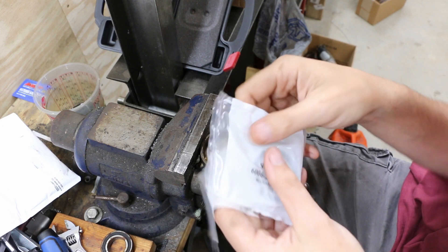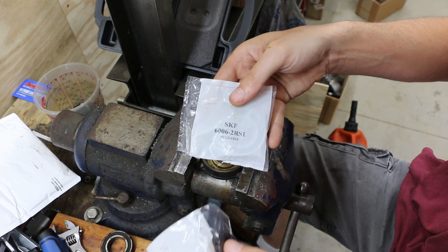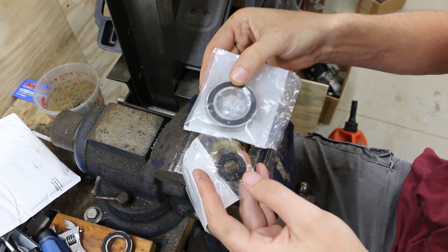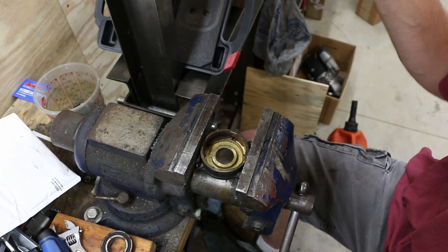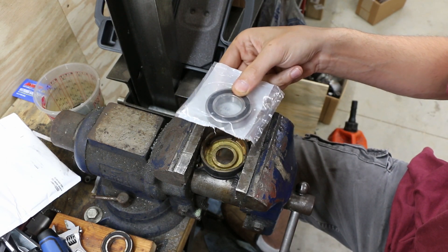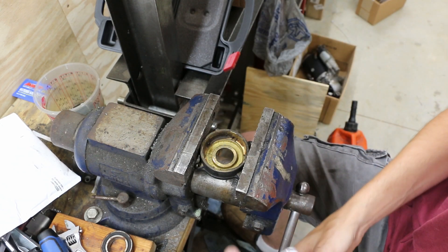When it comes to the new bearing and seal, I debated heavily because the kits you can buy for these oftentimes come with just Chinese bearings — no name brand. So I got an SKF bearing, which SKF evidently makes in Bulgaria now, but SKF is a good trusted brand, and I got a Timken seal. Links to these are in the description if you want to use better quality name brand parts. Otherwise you can just get the kit, which I'll also link, because it is a bit more comprehensive and you can have everything all in one go. We're going to take this and press this into the housing — you can use a hydraulic press or a bearing driver.